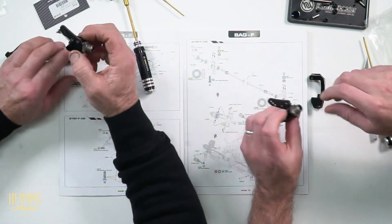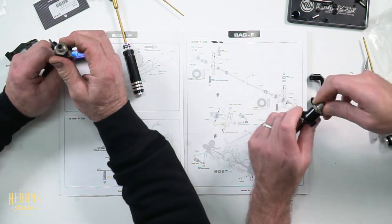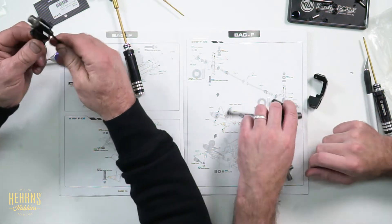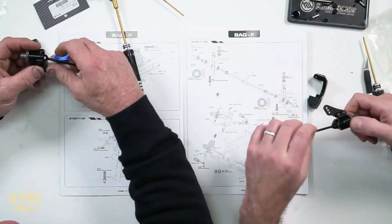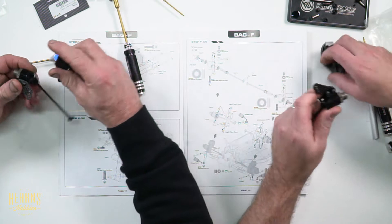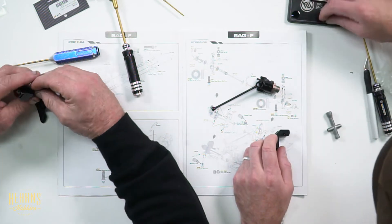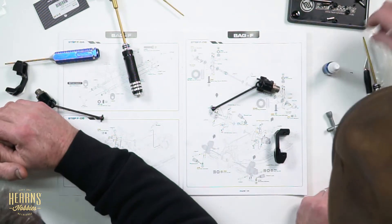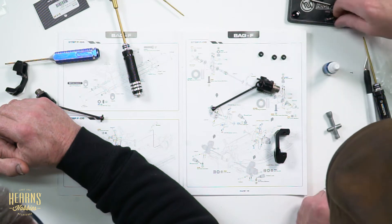If your kit comes with an open wheel nut, just get some closed ones - closed end wheel nuts over the top. How's yours looking mate? Free as a bird. So now we get to put the hats and stuff in - the mad hatter. The pins and more grub screws and a little bit more Loctite. Has this got different hats for top and bottom? There are different hats available as a tuning option, but the ones in the kit are the same - they're neutral. So there's offsets of one and two. The black one goes to the top and the silver goes to the bottom.